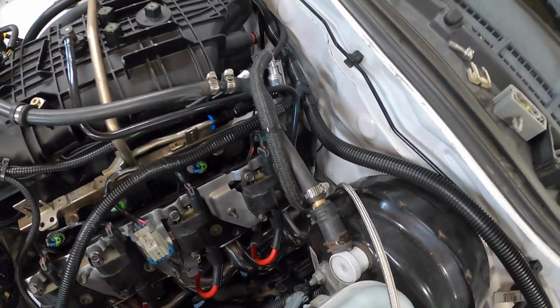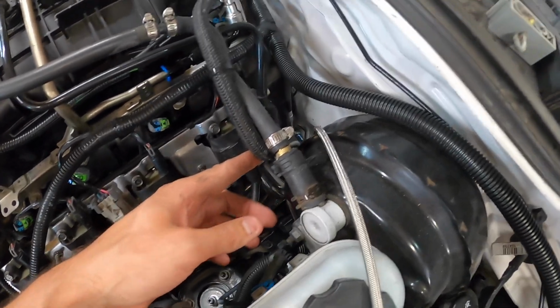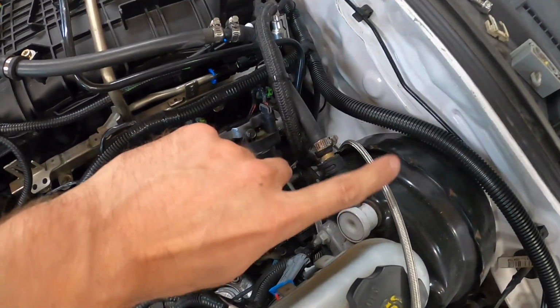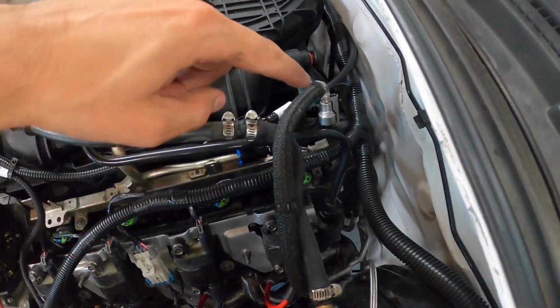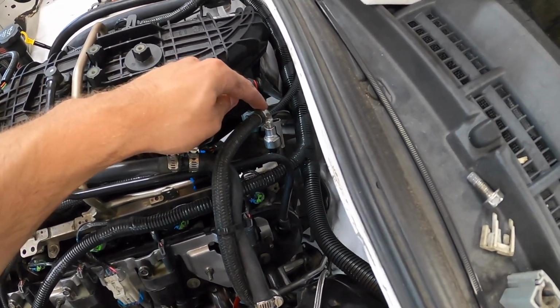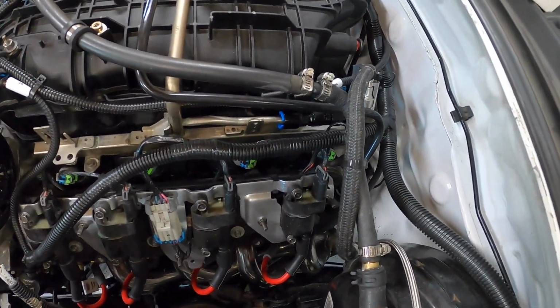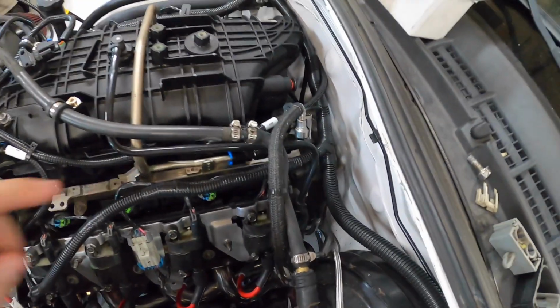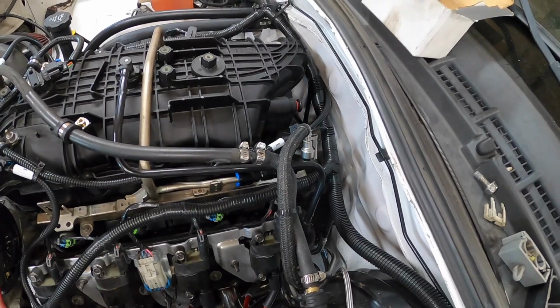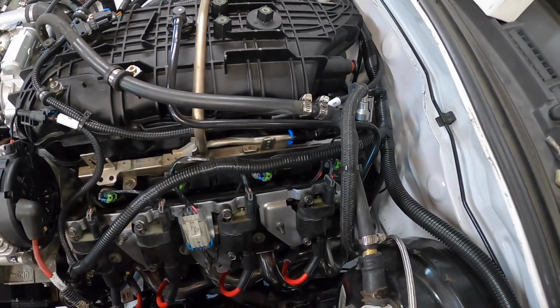Looking at the top portion of the fuel system. So you have the factory fuel line coming up here, basically ending right around where the brake booster is, and that's where it goes to the factory rubber line, over to the 3/8 factory quick connect fitting, and then to the LS fuel rail. So I played around with this a million times. I tried to get the factory Colorado fuel line to mate up with the LS, and it just wouldn't go.